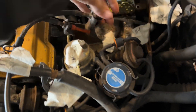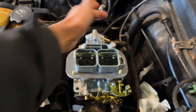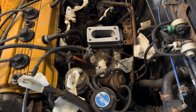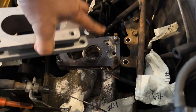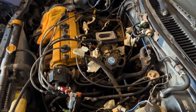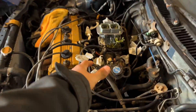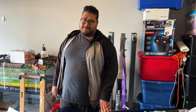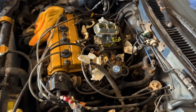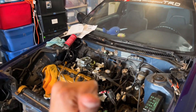You're going to have two different throttle cables — one that goes to the transmission and one to the pedal. The next issue is fuel: you'll need a regulator between the fuel hose and the carburetor. You also have to account for coolant passages — there are two holes that go underneath this plate. And we've got to figure out the vacuum line routing. We're slowly trying to gather information and fabricate this onto the SR5. There's not a lot of information out there, but as soon as we figure it out, you'll figure it out too.